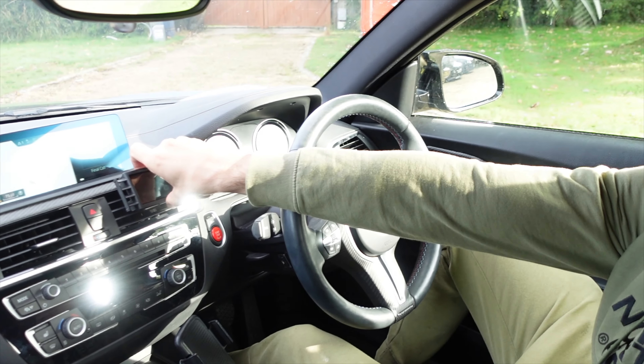Well, it's going to have a lot more stuff done to it than just tuning, but we're going to send it in for some power upgrades. Before we do that, we want to take a check on all of the baseline numbers that this car is putting out — in terms of performance, power, intake temperatures, exhaust temperatures, that sort of thing. We can't readily get that information out of the car in its stock form, but we can do it with one of these. This is a little information data display that will sit in the vent just there. Today we're going to fit that because it's going off next week for its power upgrade.